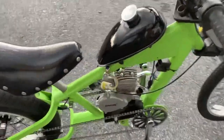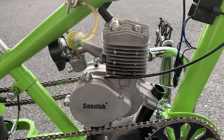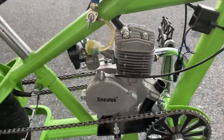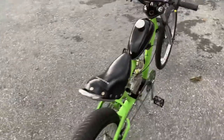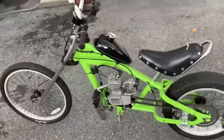If you're looking for a bike kit or engine kit, this thing so far has been pretty bulletproof. It starts up real easy. I'm running 32-to-1 in it — I think it's a little rich, but I'd rather be safe than sorry. We probably have about two hours on the whole bike. We're actually getting ready to sell it because the kid doesn't use it anymore — he's got dirt bikes now and wants a four-wheeler.